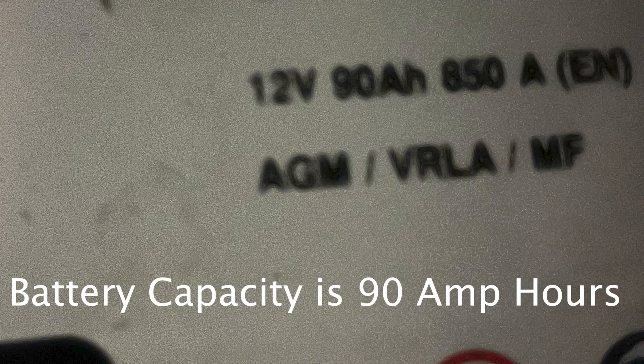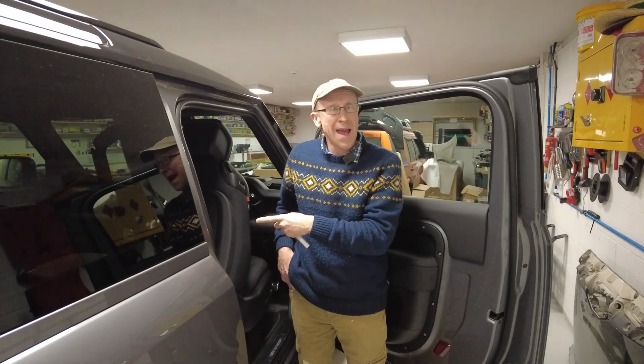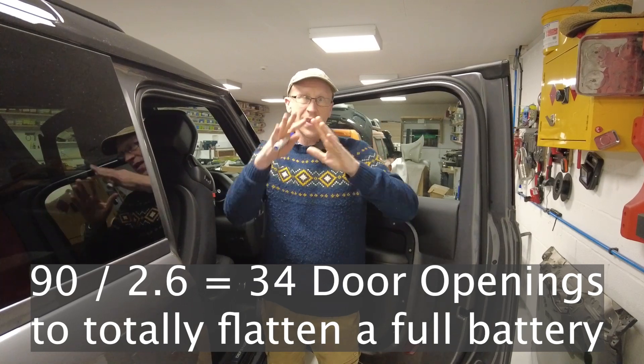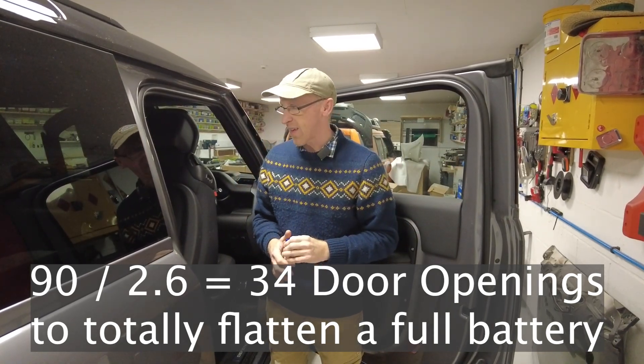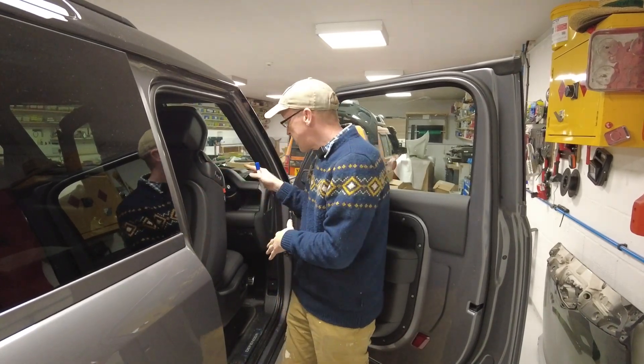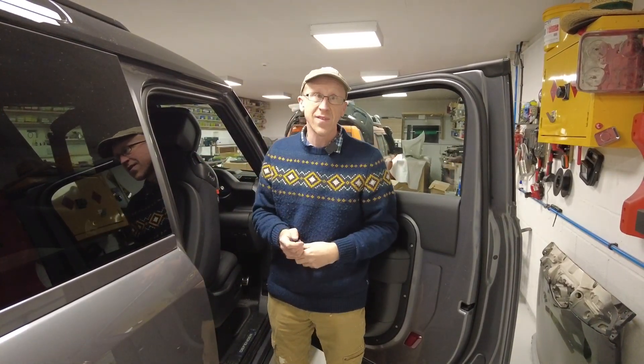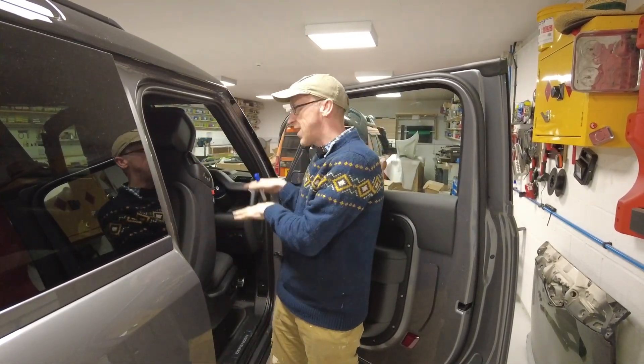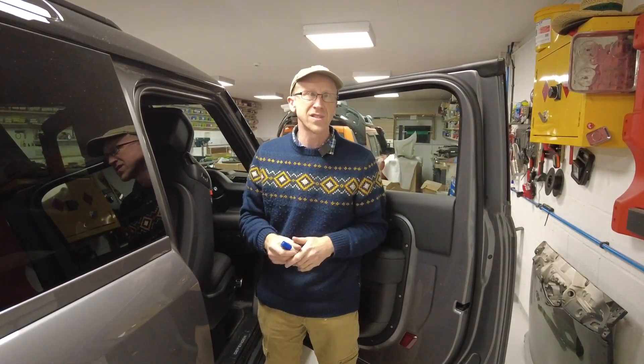So that's 90 amp hours. Let's have a calculation — I'll put the graphs up and then you'll see from the graphs how many cycles of 13 minutes with that curve would it take to consume the 90 amp hours. I think we've done all we need to do now. We can now start changing some lights, adding some accessories, adding some real lights — but at least we've benchmarked to factory standard, newly delivered, latest software Land Rover Defender current consumption.